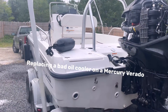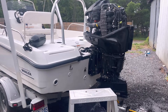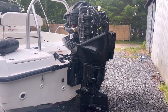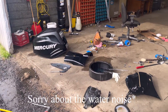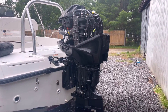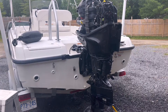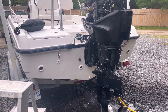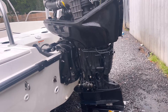Welcome back to Schneids. I came into work early to look at this boat for a friend — it's been bothering me all night. It's a 2011 Verado 150. I did a water pump, oil change, gear oil change, went over the whole boat, lights, everything. He just bought it. I took it for a test run, ran good, he took it out for 15 or 20 minutes yesterday and it puked out almost all the oil. He had to shut off the boat — got a low oil pressure and it went into guardian mode.